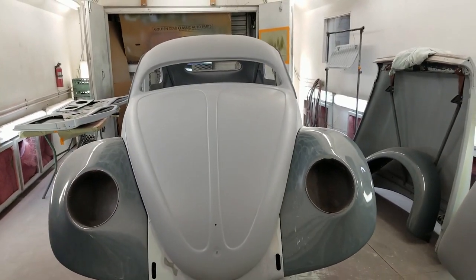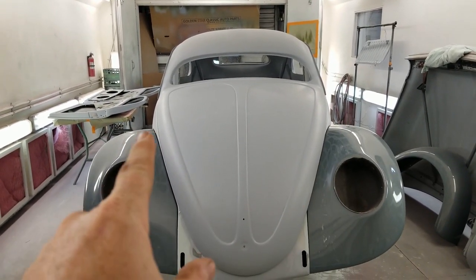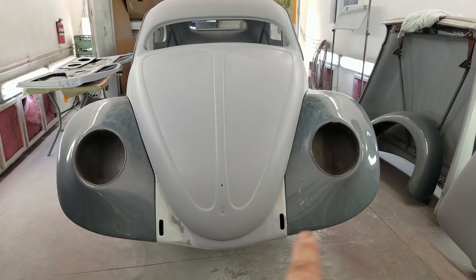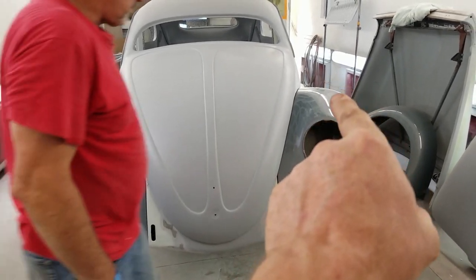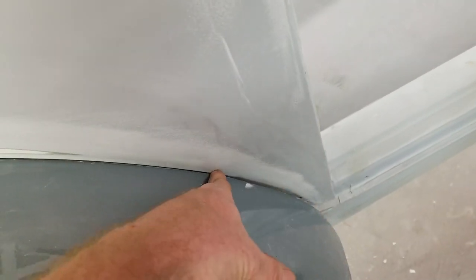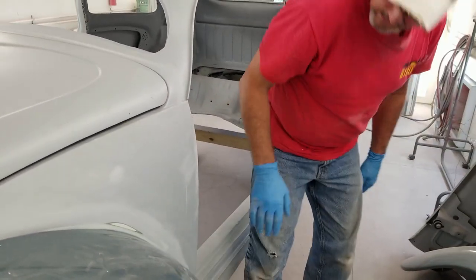Yeah, well, what I'm going to have to do on this is bring this down and forward a little bit to bring the hood tighter over here and loose it over here. But for the most part, this is looking good. And then we're going to bring this glass fender down into this apron. And then we're just going to work this one the same way. The other side, like you said, this is what I want to do. I want to just put a little bit in that jamb down into here, and that'll fill that void. I don't need to change this. I just need to add to that. Right. And then that'll close that gap up and call it good. Bring it all back in. Yeah. Even.